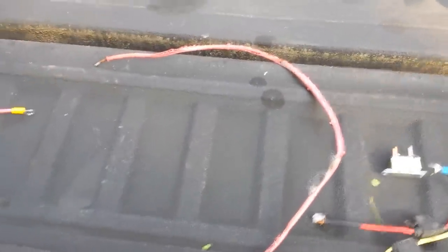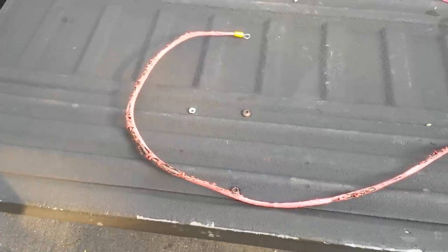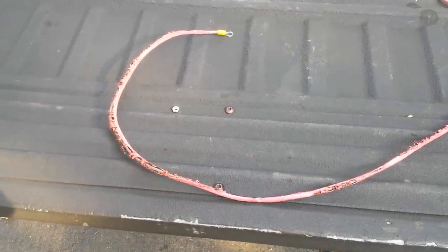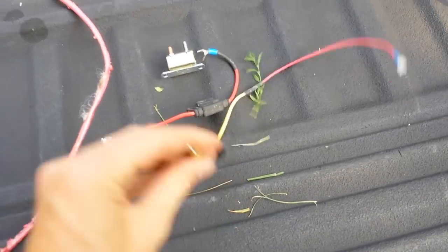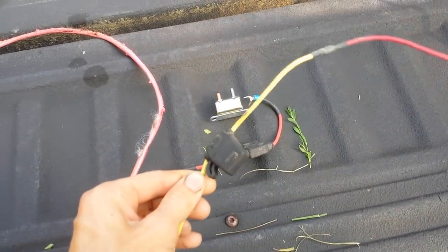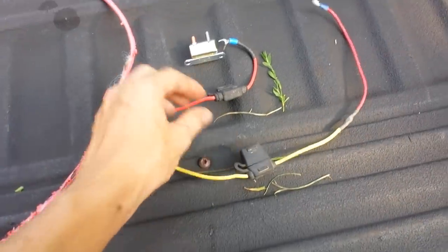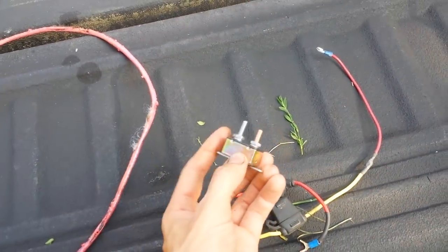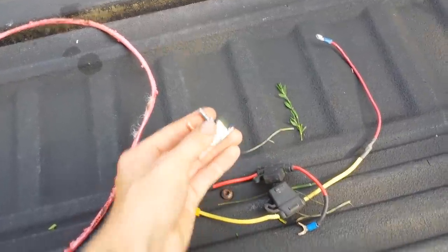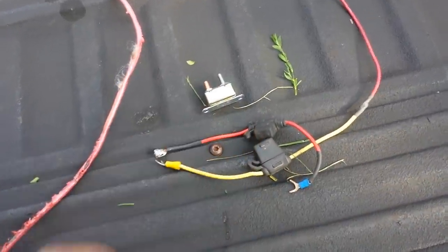This could have ended up in a vehicle going up in flames. So I just figured I'd make a quick video on this. Whenever you're doing auxiliary wiring, it doesn't matter what it is, my personal recommendation would be to have one main wire from the battery and go to an accessory fuse panel. But regardless, even if you only have one accessory, make sure you either use these things — they're just accessory fuse holders — or one of these, which is a circuit breaker. The benefit to the circuit breaker is if it trips, it just resets automatically. You don't have to replace a fuse.